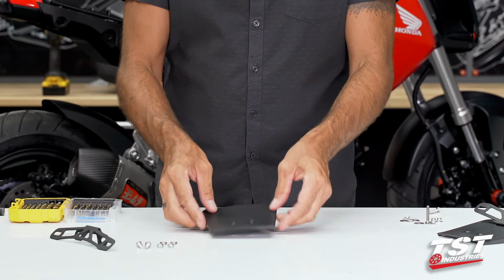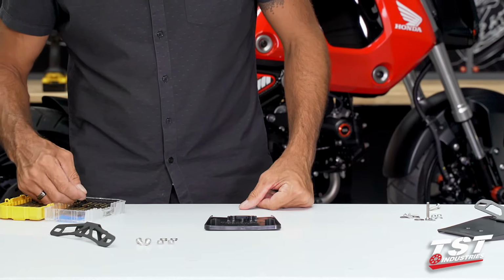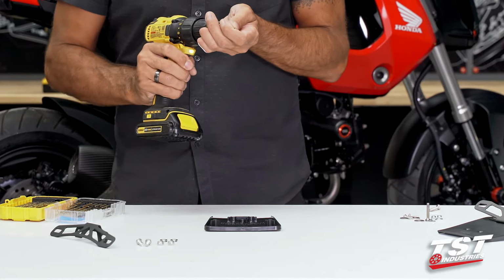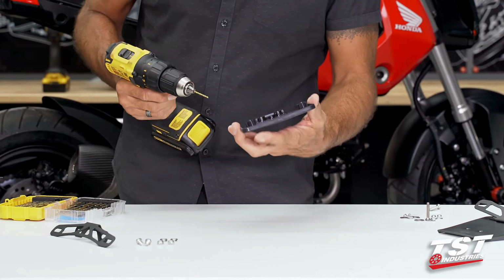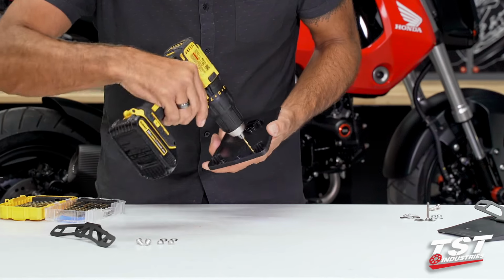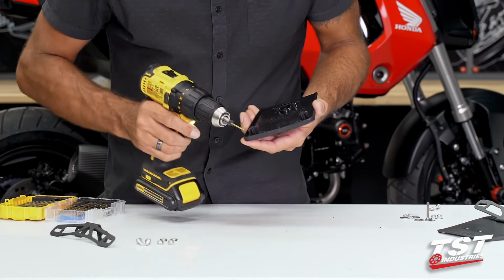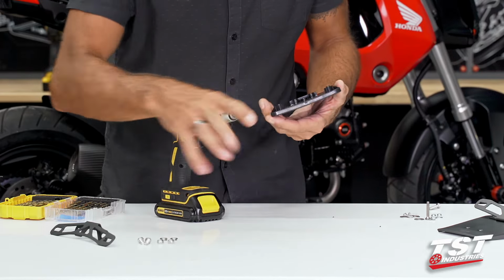All right. Let's start by selecting the appropriate drill size. I like to start with a 3/32 drill. For guys that use metric, that'll be roughly equivalent to 2.5 millimeters. So I'm going to go ahead and drill right through that center. Make sure that you don't have any body part on the back side of where that drill is going to exit.